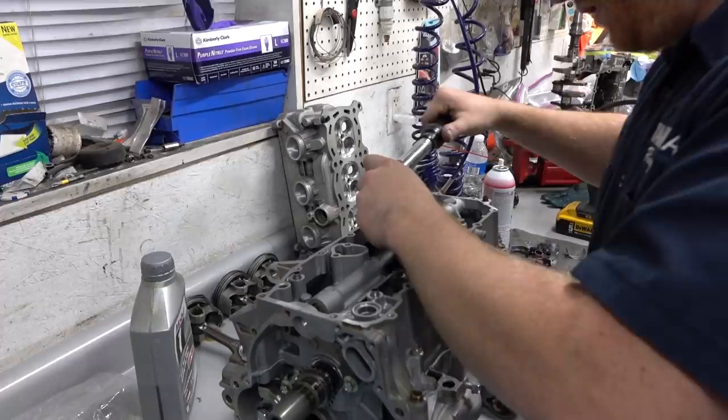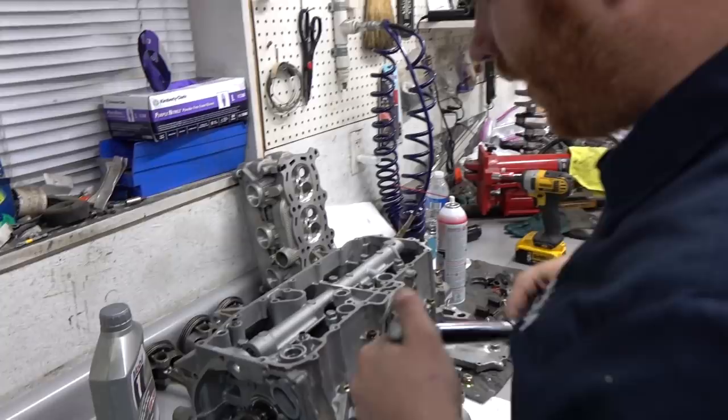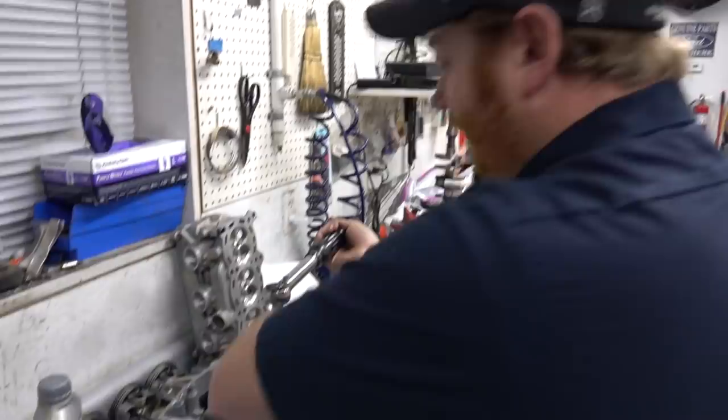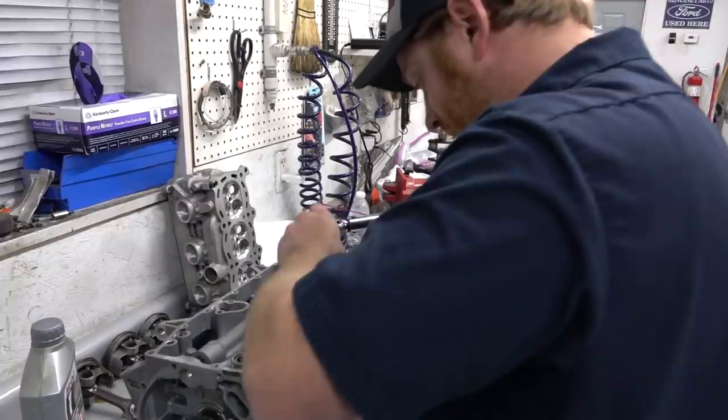So what's the torque? It's 11 foot-pounds, and then on the long bolts, it's 95 to 105 degrees. So you go to a torque, and then you go to an angle in a typical torque-to-yield setup. And then on the short ones, it's 11 foot-pounds and I think 75 to 80 degrees. So nice, man. Just get a manual. I think you can buy just manuals on a CD for real cheap. So yeah, that's what we did on eBay. Totally didn't download it.